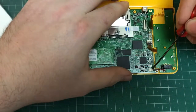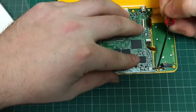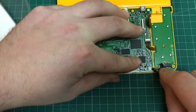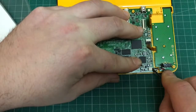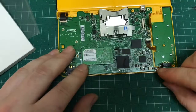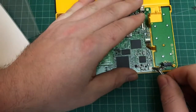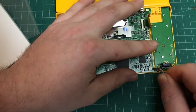This is the moment I realised to get access to the digitizing screen, I had to remove the power cable, I believe. It's a little bit awkward. You just need to prise the cables out of a little clip they're in, and then lift up the white connector. It lifts upwards, not slides. It doesn't slide out. So just be careful and ease it up. And then also, the ribbon cable above has to come out, which is taken out the same as the other cables.